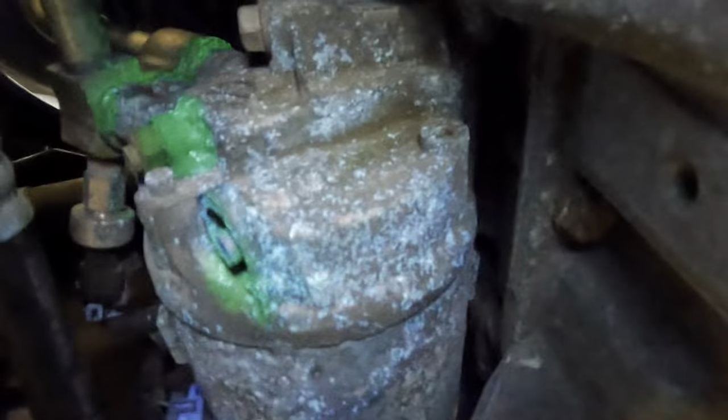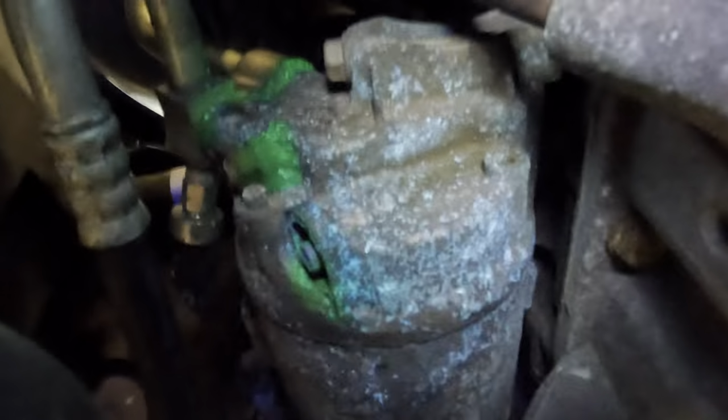Let's see. Now what, see all that splotchy bit of business right there? That's not actually refrigerant dye, that's corrosion. This corrosion is almost just as reactive to the light as the dye is. All that up there, that was caused by me when we took the manifold off. This was the bottom part of the line right here. So what we see here, that's not really much to worry about. I think we're good with all the external components.